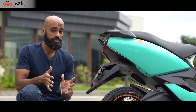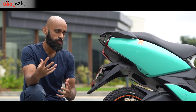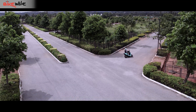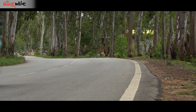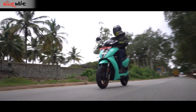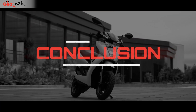Ather has also revised the suspension tuning to accommodate the bigger battery pack, the wider tyre, and the added weight they bring, but the tuning is still on the sportier side. What you get is a sporty-handling scooter that feels really nice when cornering or flicking from left to right, but at the same time it compromises comfort levels. The sporty suspension tuning isn't very forgiving on bad roads and you feel most of the undulations. Take it to wide, twisting roads though, and the Ather 450X will put a wide smile on your face.